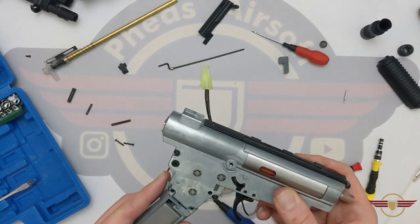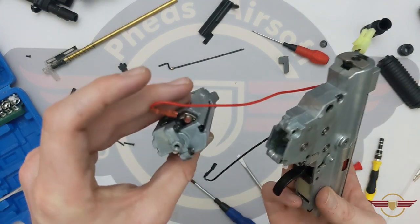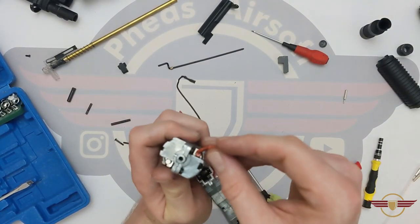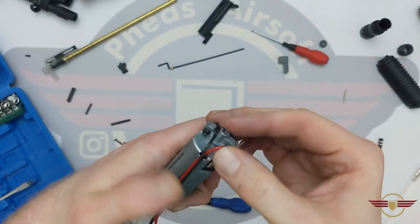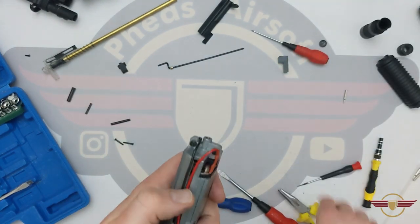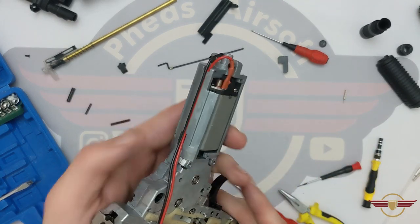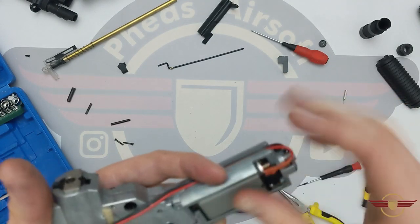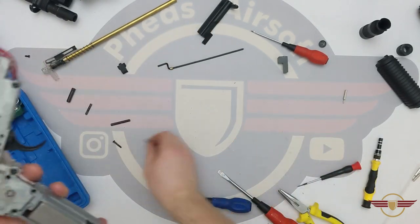Next I'm going to bring in the motor and put the wires back on first before I do. Red on the red terminal, black on the uncoloured terminal, and then we can screw it in. The connectors just needed the needle nose pliers to push down, which means they've got a really snug, secure fit — which is obviously quite reassuring. And what I've also done is put the wires in this track, which sort of keeps them positioned and out in the correct place where they should be, to keep them out of trouble and stop them from getting damaged and snagged on anything else.